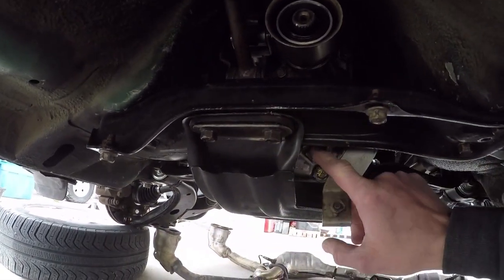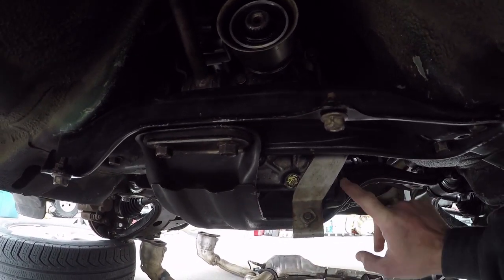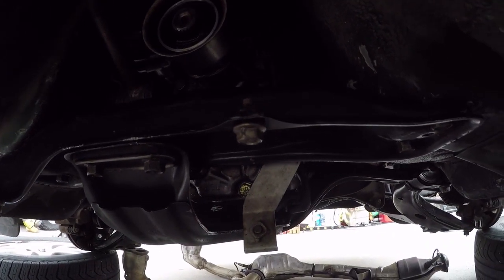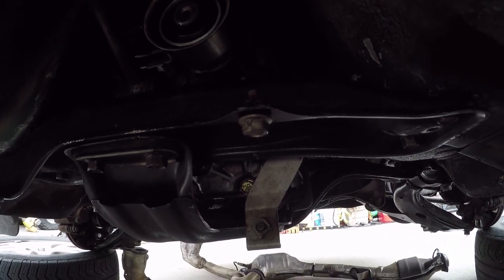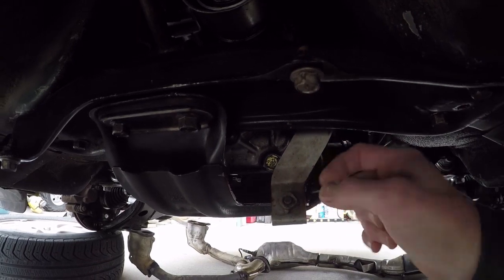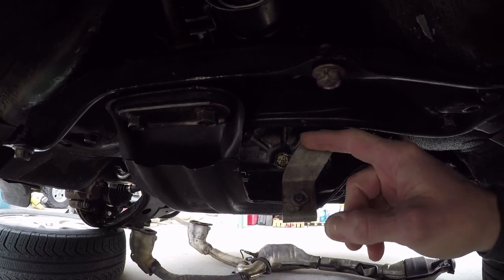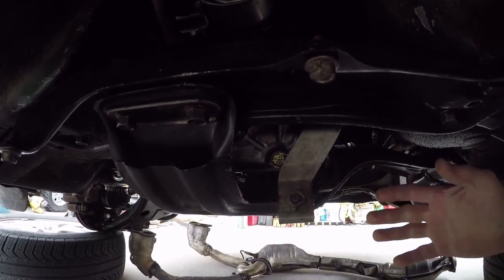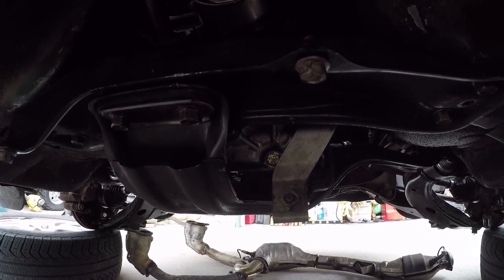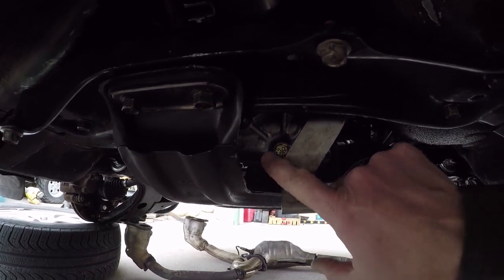shaft or the back end that have a pretty good howl on them, but that's the problem. I pulled it out, had no idea about any problems it might have had. There's no information on it. It shifts great, everything's good, but it's just the bearings are bad back here. I've already had to change one of the bearings, but had no idea how bad it was because of where it was at. Drove fine about 60 miles, then it started howling again. Pretty sure it's the bearing.